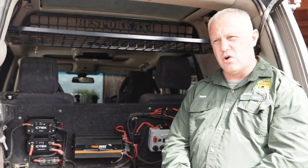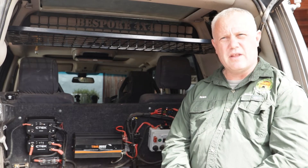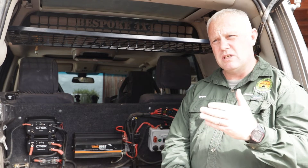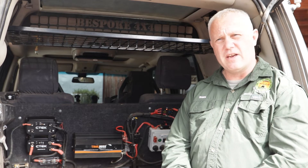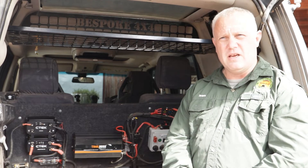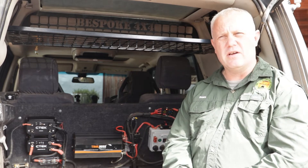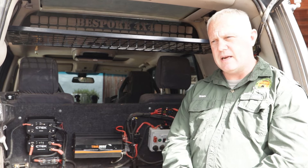You can see what the vehicle is doing while driving — we've got a monitor in the front. I've got various time lapses and you'll be able to see that. You can actually see the CTEK getting into the battery and charging it up as quickly as it possibly can. For the user in an overland situation that is important, because unless you've got those batteries backed up you're going to have a real problem. Some charging systems out there won't give you the 14.7 volts needed for AGM or even the 14.4 volts for deep-cycle batteries. We use the AGM, and it's been brilliant for us.